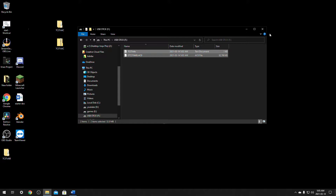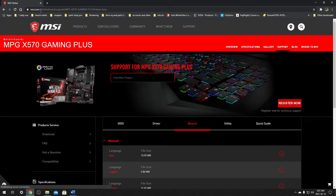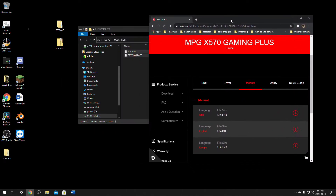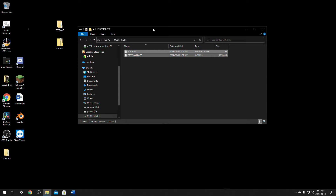I'll leave links to the manual and how to find it. On the same MSI website, once you've found your motherboard and BIOS, you can click on Manual and download it in any language. In my manual it's on page 28 — it should be somewhere around there in yours too — and it'll be called a JBAT. I wanted to make that very apparent so you know what you're getting into. It's not a scary process; there are lots of ways to fix it. This doesn't have a big chance of messing up unless something happens to your power, so if you're in a brownout zone or it's storming outside, maybe pick a different day.